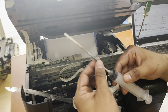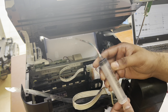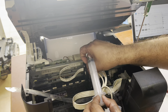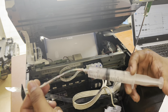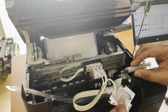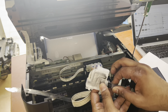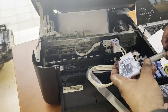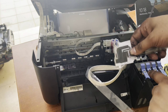If the ink is already in the cartridge, you need a big syringe with a small pipe. Fill it with about 5 ml of hot water, place the pipe to the nozzles inside, and try to unclog the nozzle with the water pressure — the hot water will unclog it. First of all, I will suck the ink using the small syringe placed inside and you will find the ink is refilled in the cartridge from the ink tank.